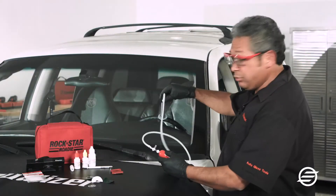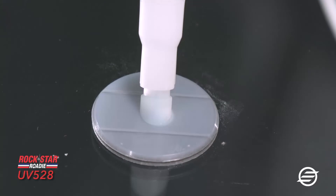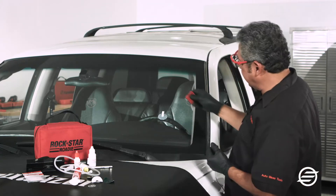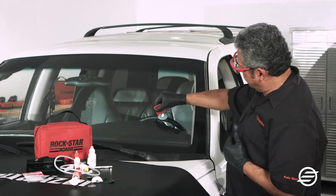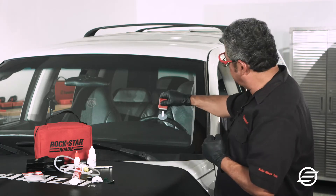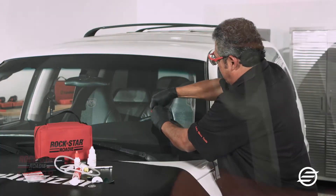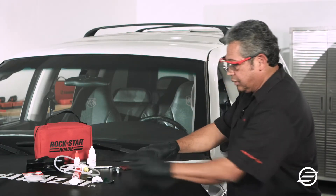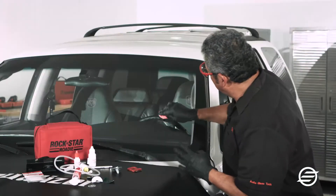I'm going to open the valve and remove the hose. Then I'll remove the ultraviolet light cover and the flow regulator. I'll use a razor blade and start to remove the pedestal. There are some grooves on the pedestal — this is how it helps you remove it from the glass. A little pressure, and now I'll get all of that off of there and wipe it off.